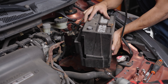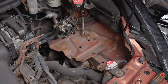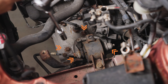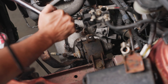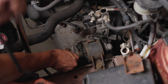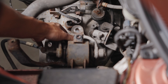The battery is actually a lot heavier than it looks — maybe I'll do a lighter battery in the future. The battery tray is held by three 12 millimeter bolts. Remove these two clips that are attached to the tray. The transmission mount bracket is held in by four 14 millimeter bolts. Remove these after you support the trans with a jack underneath. These bolts were stuck on pretty good. Now remove the bracket and set it aside.